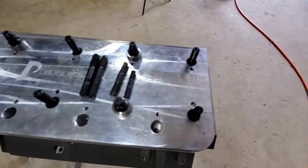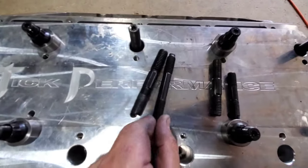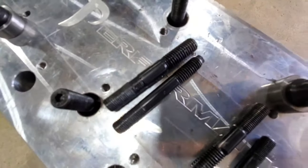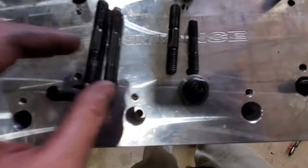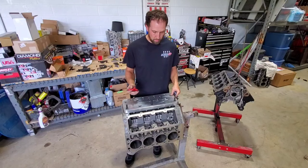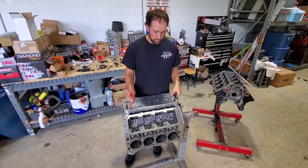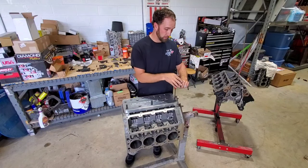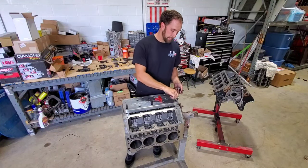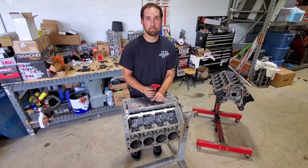Alright, so we've got all the half-inch studs in and it went pretty smooth. This is what we're upgrading to and from — this is a regular 7/16ths stud, and this is what we're replacing it with, the half-inch. As you can see there's quite a bit of difference in size. The half-inch stud provides a lot more clamping force. An LS just by design has a pretty poor head stud bolt pattern, so anywhere that we can get a little bit more clamping force, I'm going to try it. All in all it's a pretty cool plate, and if you need to do it while the engine is still in the car, you can do that. We got it just so that we can do it on our own stuff and a couple of local people's engines — it's a little cheaper than sending it to a machine shop. I'm going to go ahead and get the other side knocked out and then jump over to that block — we'll see you guys later.